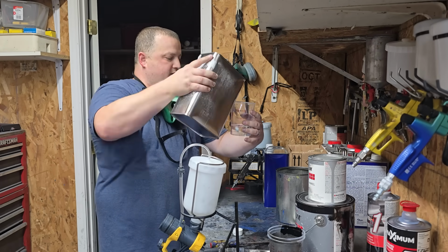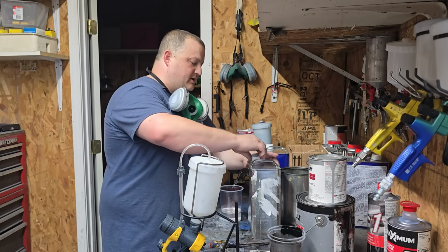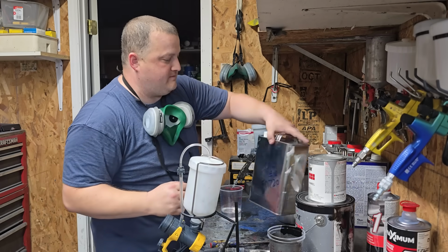Well, I have plenty of clear. And I'm going to do 1.5 ounces of hardener. And that'll get me really, really close. And I'm going to mix this up really good. Let's load up the Wagner gun and we'll get to spraying.